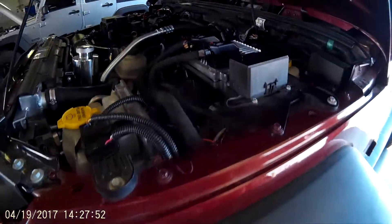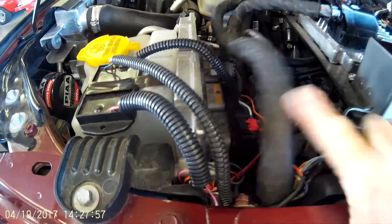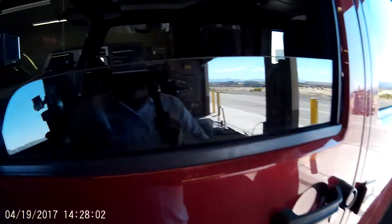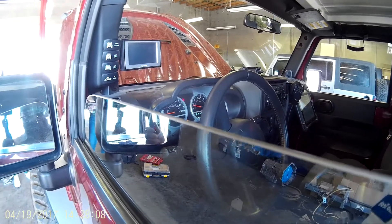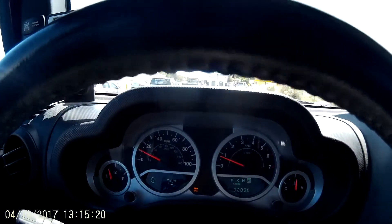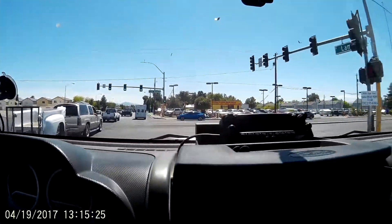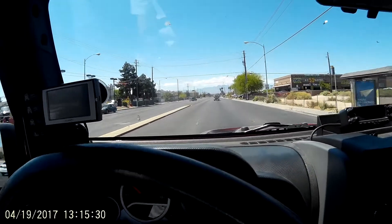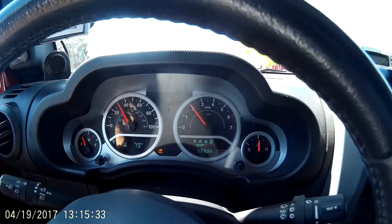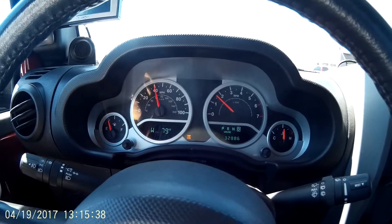As you can see here, our Jeep computer is not even plugged in. Our Jeep PCM is not in line in this network. You can see our dash functionality. Here we are in another LSJK — this is an LS3 in an earlier JK. What's different about this build is it has our CAN interface module. Almost everything in this dash is being driven by the CAN module, including the tachometer, the prindle, and the coolant temp.